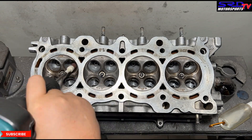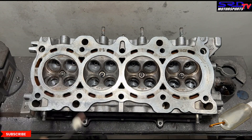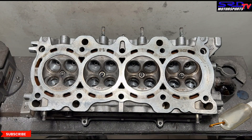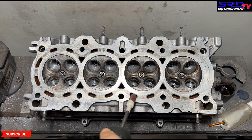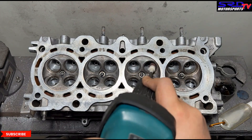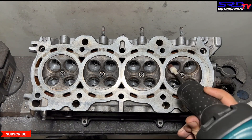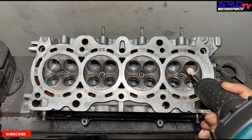Flow does not know what engine or casting it is. All it knows is it will flow when the surface is consistent and shaped well. You have to understand the dynamics of the engine — for example, whether a certain casting needs a lot of port volume or not, or if it already has too much. Now here we finish up the bowl, then we're going to wash it and bring it to the clean bench to show you the status.